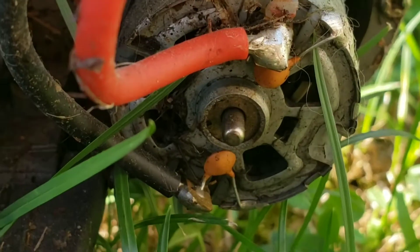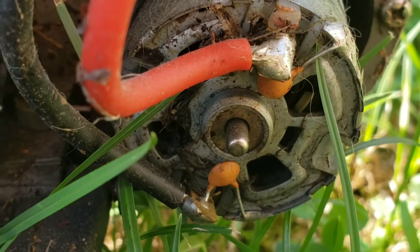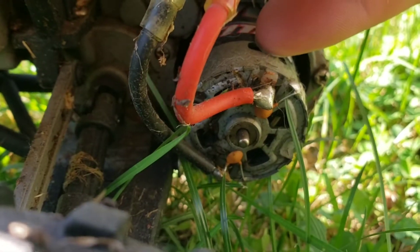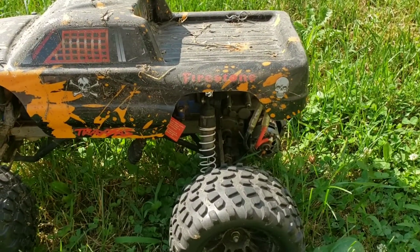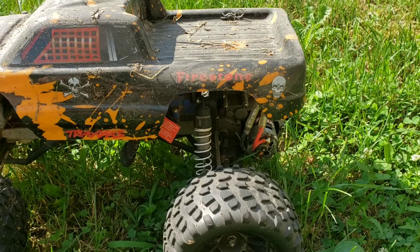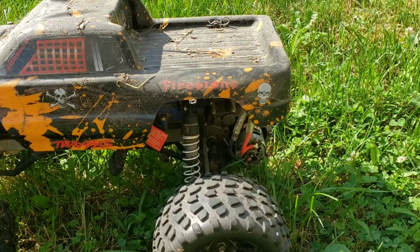You can see around that shaft — there is clearance for mud and water to get in there, and that little shaft spins. Similar inside there also, and you got all your brushes and whatnot. This is my second motor and I'm about to replace it, so I'll be on my third. They always go when I mud run because they start squawking and squealing and locking up because mud gets in.